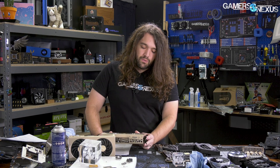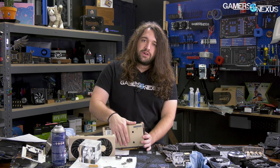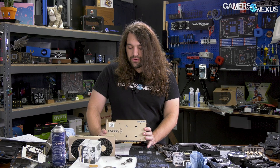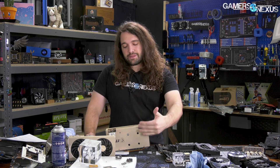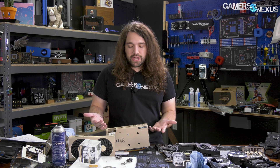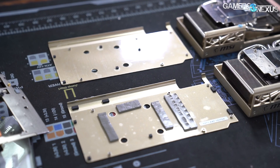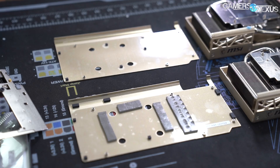What they told us was that the fix is to add thermal pads to the back plate and thermal pads to the front of the card that are more centered. They did not increase the size of the thermal pads on the front, but they centered them properly on the modules, which helped a lot. The pads on the back plate also helped a lot, because with a flip-chip BGA, a back plate with no connection to the PCB becomes a heat trap — the air can't get out and it just burns up in there.